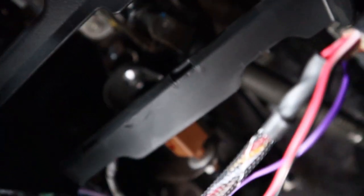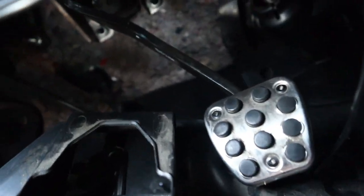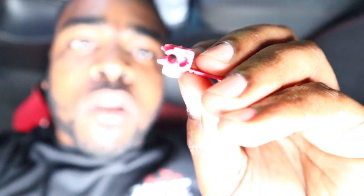All you have to do is get a quick splice and insert your wire. One side of the quick splice is blocked — that's where your new wire is going to go. The other side is where you're going to put the existing wire in. Then on the top, get a pair of pliers just to crimp them down. Once you do that, make sure it's tight — pull on it, tug on it. Also, make sure when you insert the new wire into the blocked side, you push as hard as you can to make sure it's all the way to the end, because sometimes people feel it hit something and stop there and crimp it, and they never got the wire all the way past where it needs to be crimped.